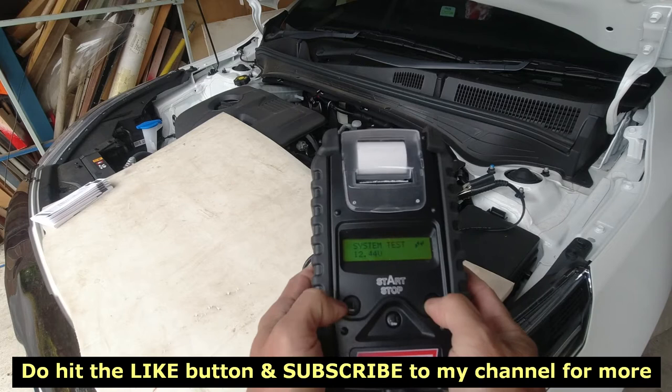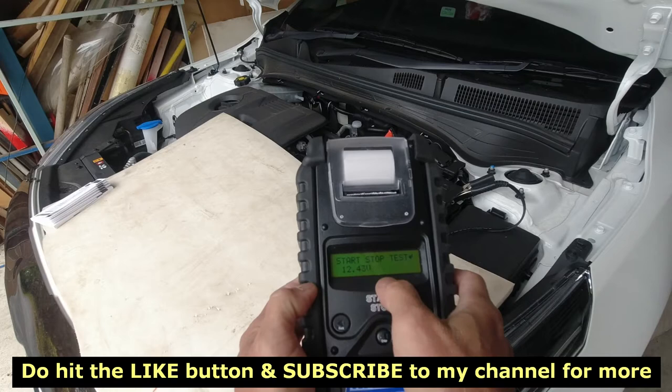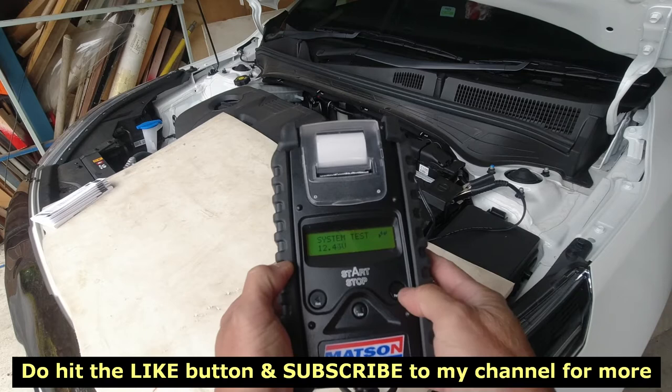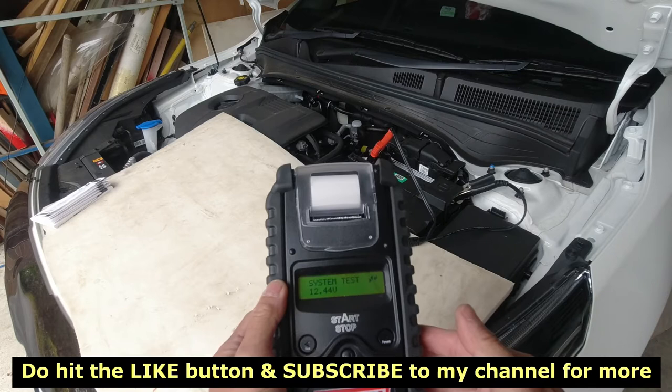If I press forward, I can choose different test options. This is to test a battery that has start and stop capability. That's to do an ordinary battery test. I can choose the language. If I press enter, in this case I've selected English. I can also do a system test. This is where the test involves starting the engine to monitor what the alternator is putting through the battery. We will do that later.